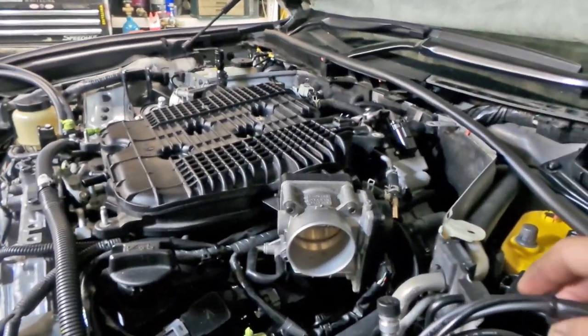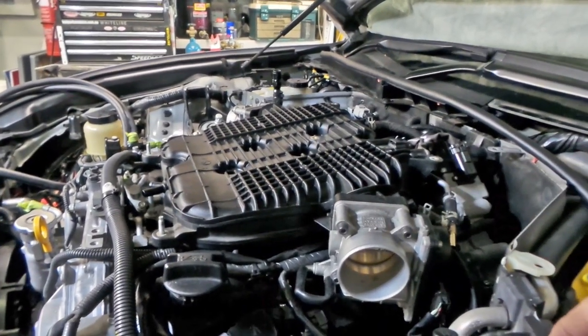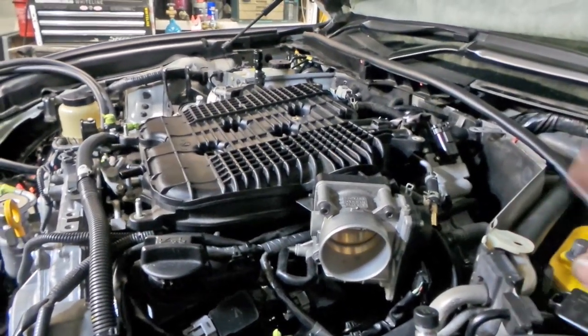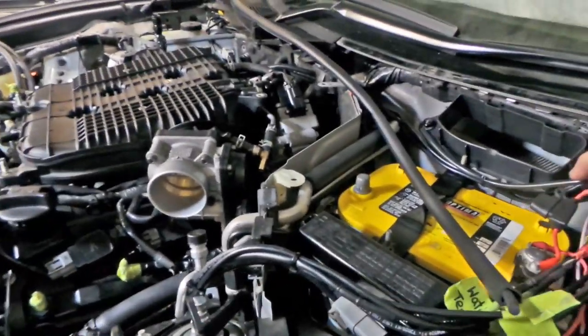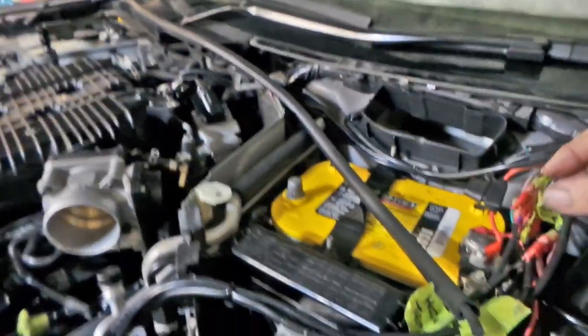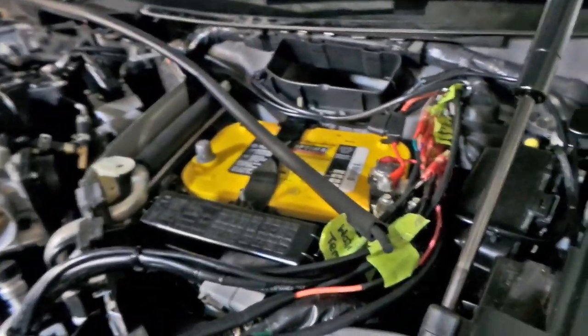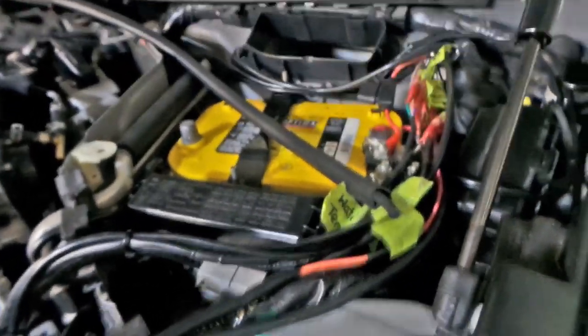And this is a typical thing. I've incorporated all of the sensor looms onto the engine in such a fashion that they just have a main disconnection point now, instead of having to disconnect them individually off the motor. And they're just run up into this conglomeration here, which I am still probably going to like to do something with. Unfortunately, I have to keep all of the connectors separate so that I can, if I want to, strip them off. Otherwise, I'd have a big connector up here, maybe a 12-pin connector or something, but it's just not convenient for me at the moment. And the 2-pin connectors that I have are all a little bit large.